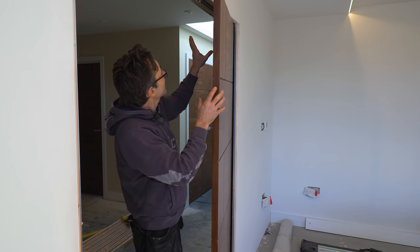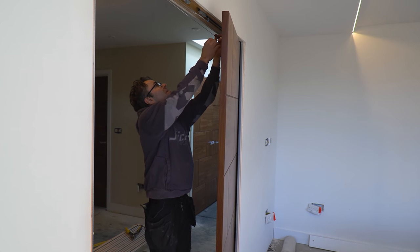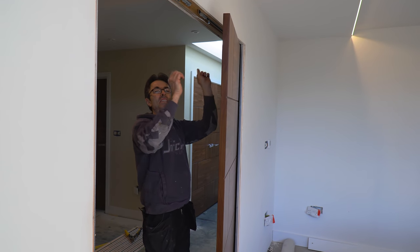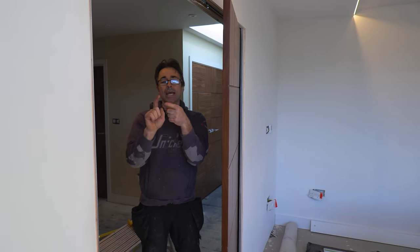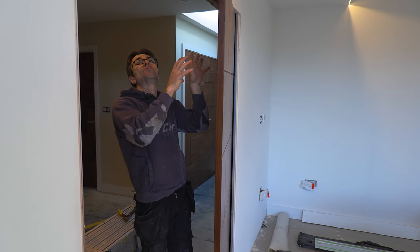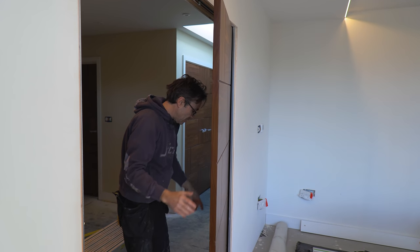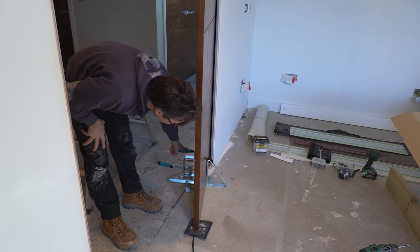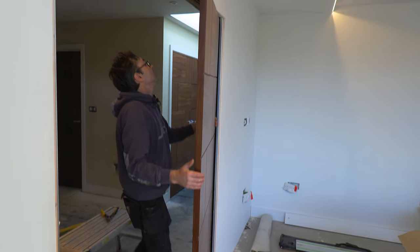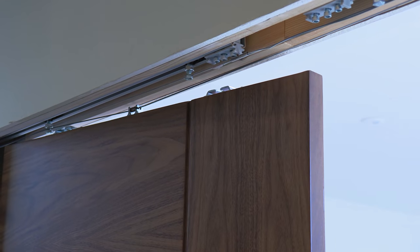So the idea is I'm going to carefully maneuver this into place to get the brackets back on, and also the little ferrule here which is the restrainer for the SIM kit — this is what pulls both doors. Because the bracket has a hole in either side, we need to twist it on. This is the door I need to do first; the other one's just a matter of re-hooking afterwards. I'll ease that in — I've got it on a really handy door stand, with an airbag under there to jack it up and protect it as I slide it. Just going to ease that over; it's a little bit of a tight fit, it's intended to be parallel. There we go, that's in place.